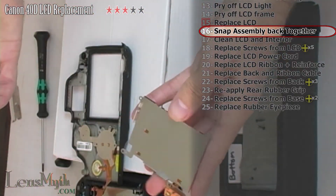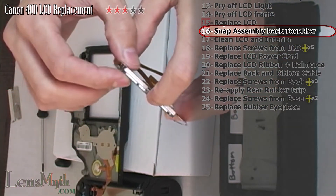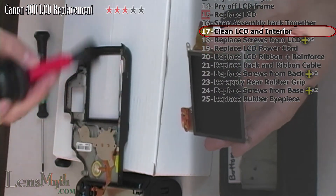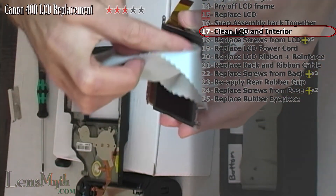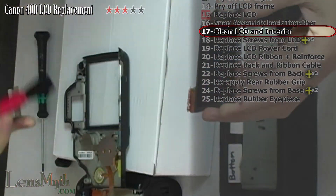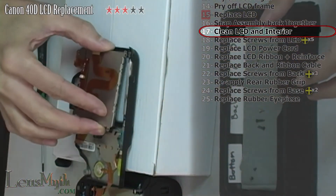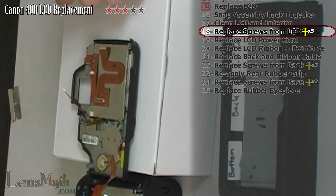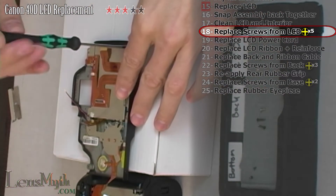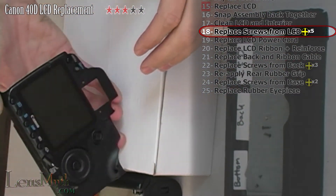Match up and replace the metal back piece to the display assembly. Thoroughly dust the inside of the camera and clean the LCD screen, then replace it side down. Replace the five identical Phillips screws for the display unit. Check the back side to make sure it's assembled properly.